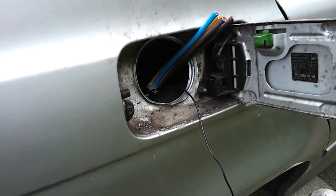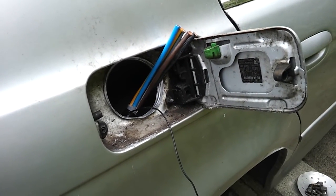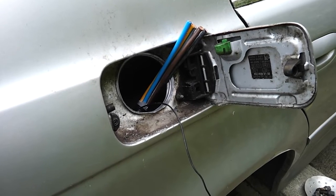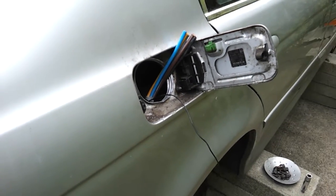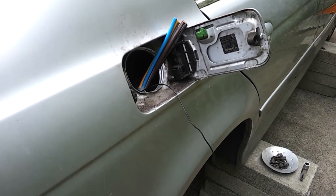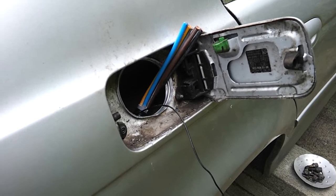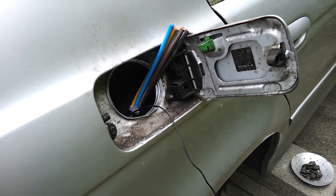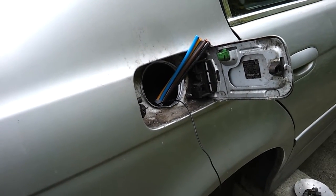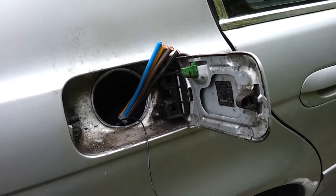With this car we've got quite a large capacity battery in excess of 35 kilowatt hours, so we need to be able to charge that and I'd like to charge it quickly. We're looking for the 7-pin 63-amp IEC 62196 Type 2 inlet — the type used on the Renault Zoe for AC fast charging. I can get the 32-amp one pretty much mail order, but the 63-amp is proving to be a little bit more elusive.